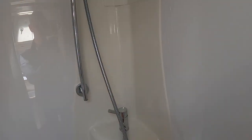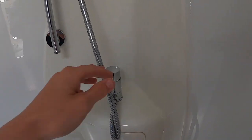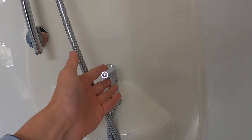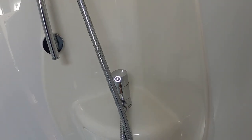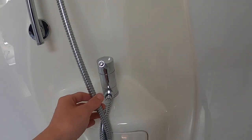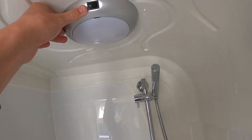Another important winterization tip: take your shower head off the shower hose and allow the shower hose to lie in the shower tray. Make sure that every tap within the van — kitchen tap, bathroom tap, shower tap — is left in the open position on the mixer. This stops any air building up and prevents an airlock from forming.